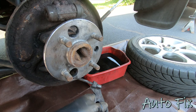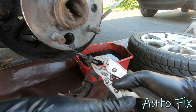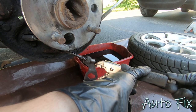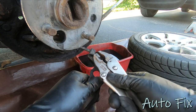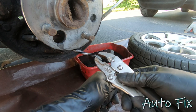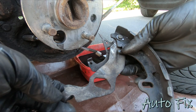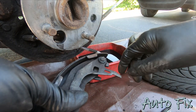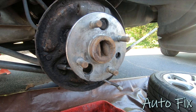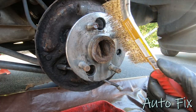To remove the parking brake lever, you basically compress the spring and make it come out. I'm going to lock some locking pliers onto it so I can grab and hold it, then just twist — and there you have your arm with the shoe. I'm going to give this a little extra scrub to remove the old anti-seize.